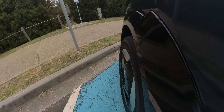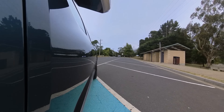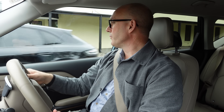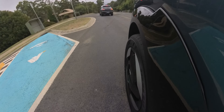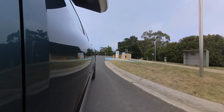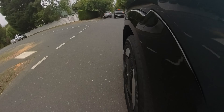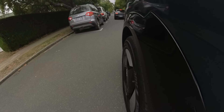I've reset the odometer and we are starting out with 68% battery. Where possible I'm going to get up to the speed limit as safely as possible and then put cruise control on straight away so I've got a consistent speed. I've also got no air conditioning on — very important, because the temperature here on the mountain might vary so significantly that the energy the battery needs to run the aircon will affect our result. So I need to take that out of the equation.